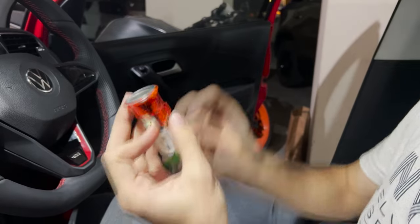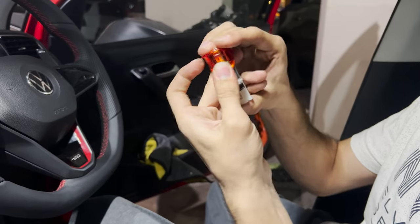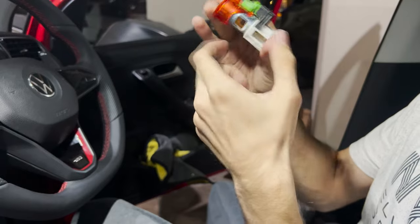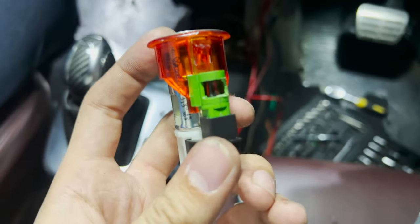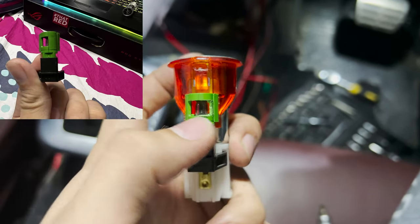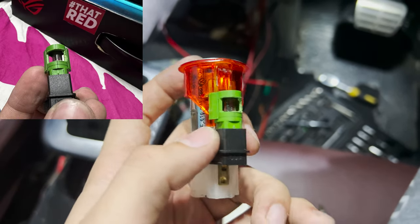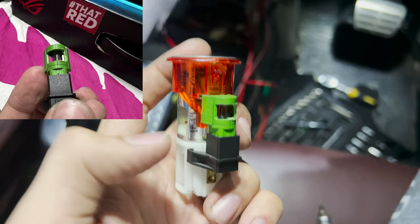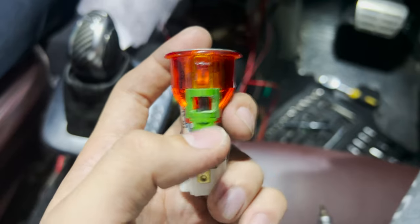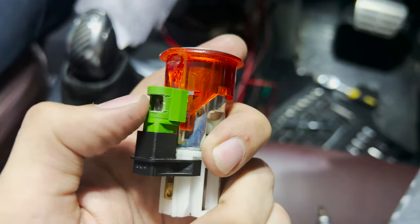Install the illuminated ring on it — just like that. Don't forget its bulb which clips in right there; it makes contact from these golden pins on itself so you don't have to do anything. I had slightly modified this green part — you can see it has a small cut. It used to cover halfway; now I've made it open entirely because it was designed for a different car. In the Jetta it used to light up the ashtray, but here we want to light up the entire red reflector that's in front of it, so I had to cut it open entirely.